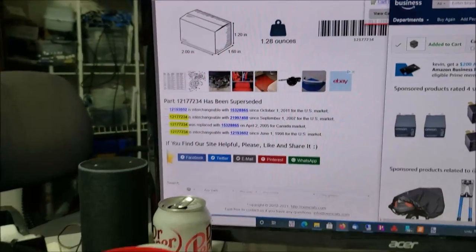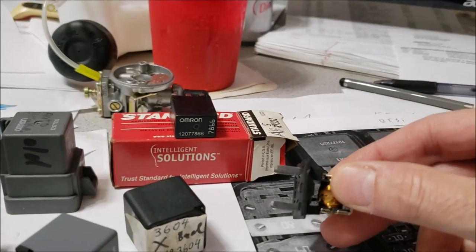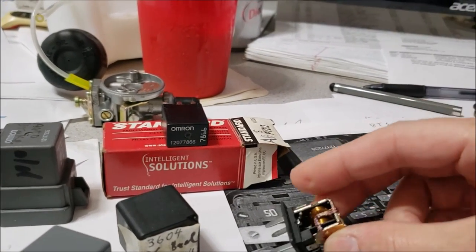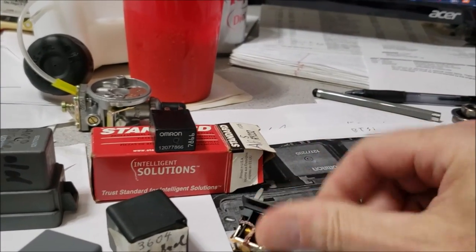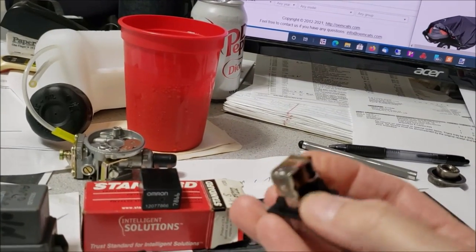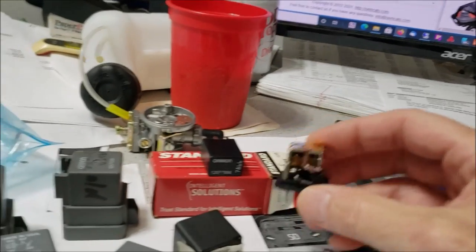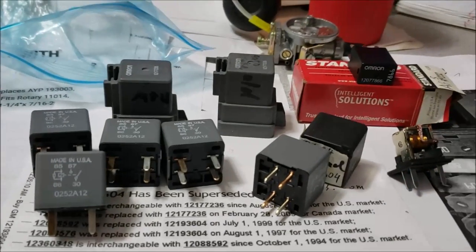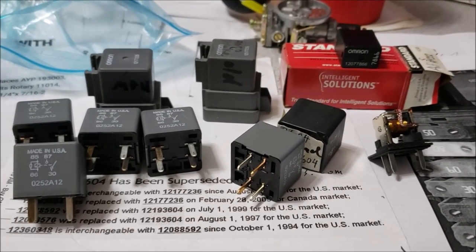So I'll get two of those — that's the way you can track down the correct relay with a little extra work, but you'll know you're getting the right part. I'll put all these different part numbers down in the notes section of this video. This is cheap insurance — you don't want a little $3 relay to ruin your vacation and have you stranded at a gas station. Go through your RV, understand how it works, where the starter relay and fuel pump relay are located. Hopefully that'll help you out. Thanks for watching and have a great day.